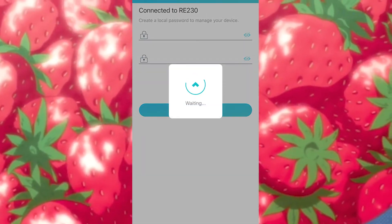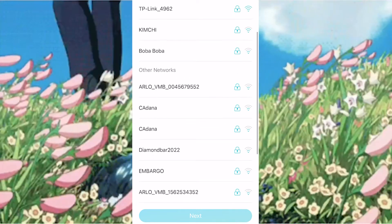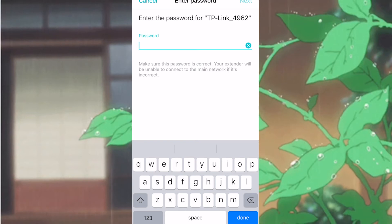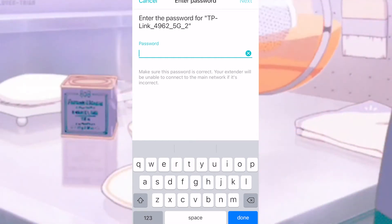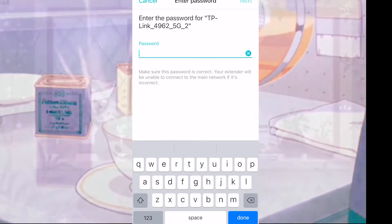Enter and confirm your password and then press OK. At this point, your extender will try to find all the nearby wireless networks that it can connect to. The extender can connect to a 2.4 gigahertz network as well as a 5 gigahertz network, so make sure you're connecting to the right router at the right frequency. Right now I'm entering the password for my 2.4 gigahertz connection. You'll do the same for your 5G network. Depending on which router you have, you may or may not have a different password — for about 80% of you, it's most likely the same password.